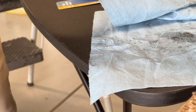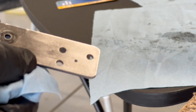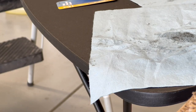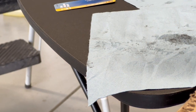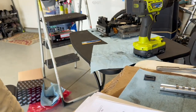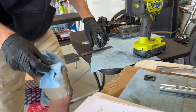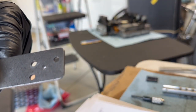It drilled a perfect little tiny hole. I wiped the schmooey off — it's old. We're going to find something to fill it in as well. Before schmooey, after — this stuff just wipes off. It's everywhere; no wonder these transmissions do crazy things when they get old, because metal paste just gets everywhere including over the circuit board. It's got a little fillet, it's clean, nothing sticking up — good to go.